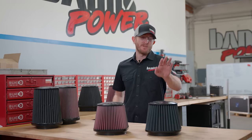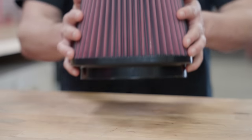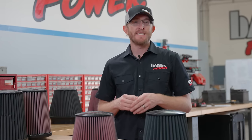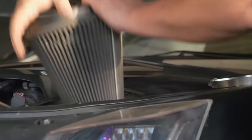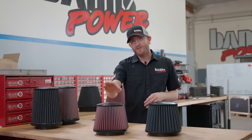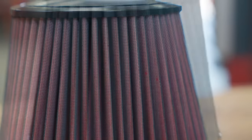When you buy a cold air intake, you're given two options: a dry filter or an oil filter. A lot of people love dry filters because they think it's easy to maintain — they're convenient, you just pick them out, tap them a few times, run some water through it. But a lot of experienced folks swear by oil filters because they have long life, they're exceptionally good at catching dirt, and they actually flow a little bit better. Let's get into it.